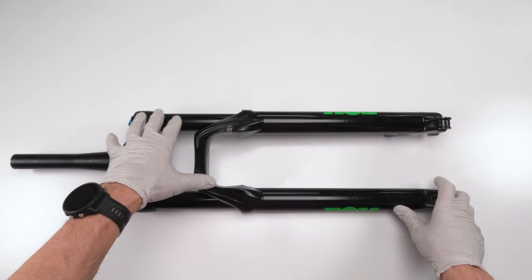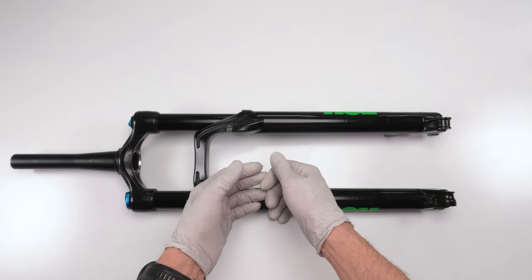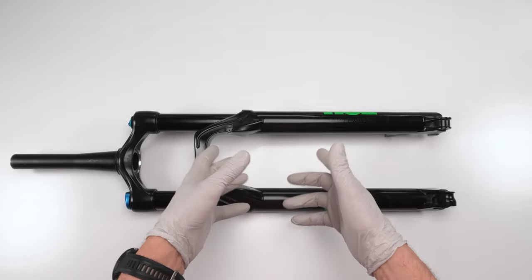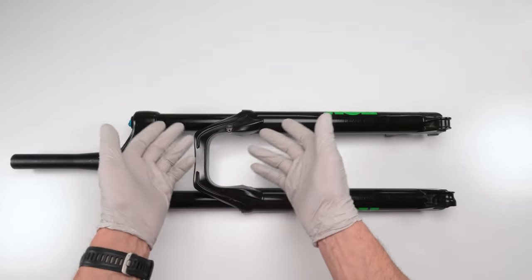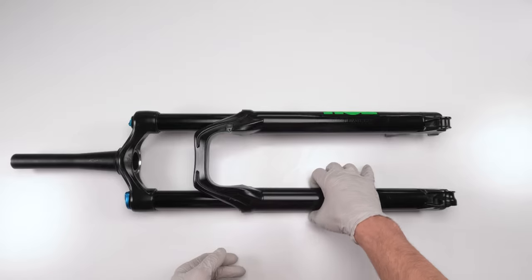The air spring, again, it's simple. You could even do it with the 50 hours. It's literally nothing more than popping off a ring, taking it out, taking out the old grease, taking out the air spring, removing the old grease, replacing it with fresh grease, putting it back in there. It'll literally take you less than 5 minutes, but you could do it every 100 hours, every 200 hours if you want. That's up to you, right? Or between every 100 and every 200 hours.